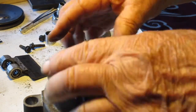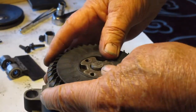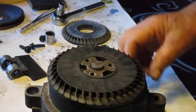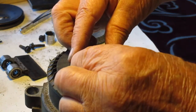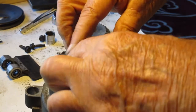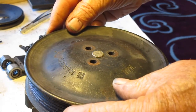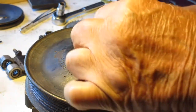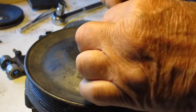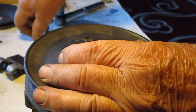Next you want to install the fan and pulley. Push the fan down all the way — it'll seat on there. If yours has a spacer, install it now and get it lined up with the mounting holes, then press the pulley on and insert the bolts and lightly tighten them down for now. You may have to take it off to install it on your vehicle, so just snug them down.